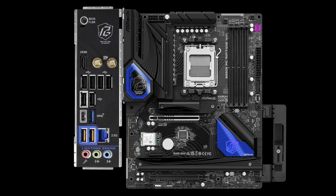Just below the two ARGB headers in the upper right corner are the debug LEDs. Let's take a look at its back panel: BIOS Flashback button, one HDMI 2.1, six USB 2, two USB 3.2 Gen 1, and two USB 3.2 Gen 2 of which one Type-C. The three audio ports are controlled by an older Realtek ALC897 codec, while the LAN options are split between two competitors: AMD with its RZ616 module for Wi-Fi 6E plus Bluetooth 5.2, and Intel with its Killer E3100G chip for wired 2.5 Gigabit.